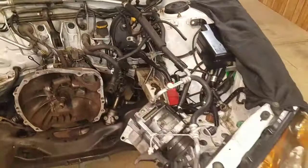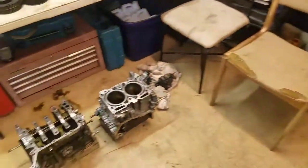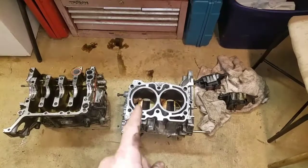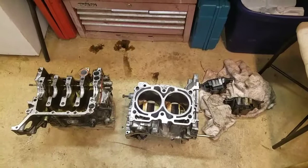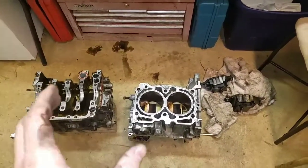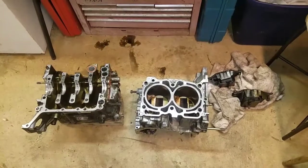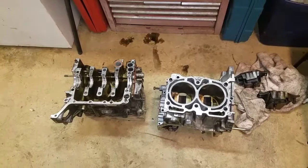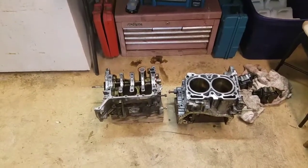I'll try to put another video up when I get the parts - I've ordered most of them online and they should be here in a few days. For the engine block I need to call locally to get it bored out to get rid of the scoring. Once I do that, the machine shop will tell me what size piston they want me to get, because they'll cut the cylinder to match the piston. That's really the only part I haven't ordered yet.